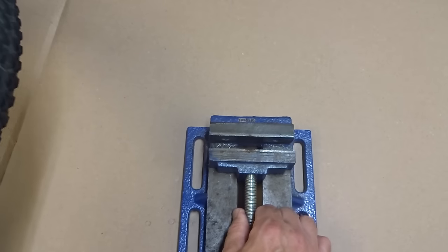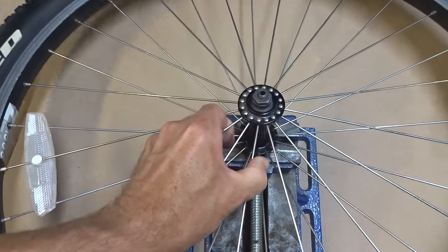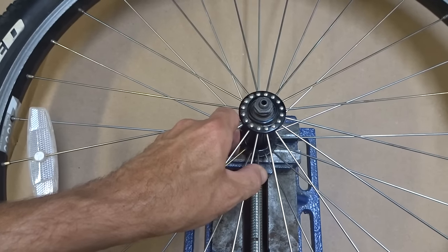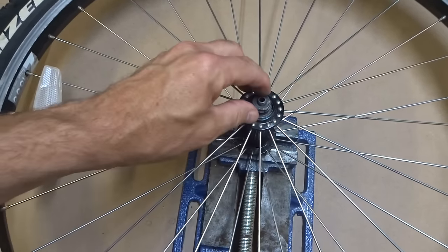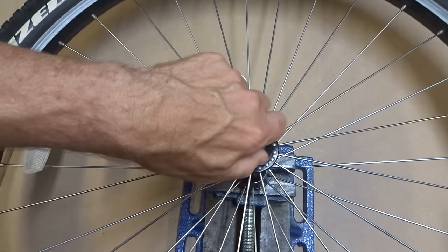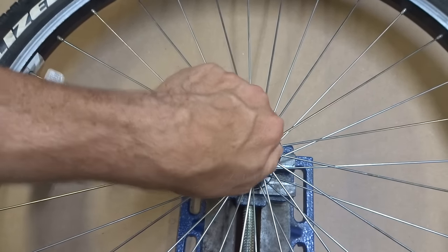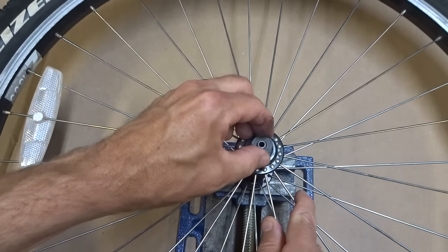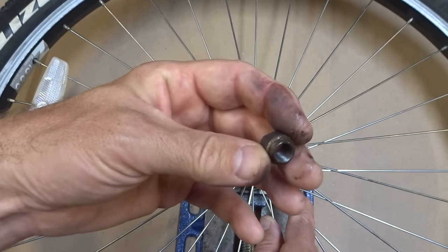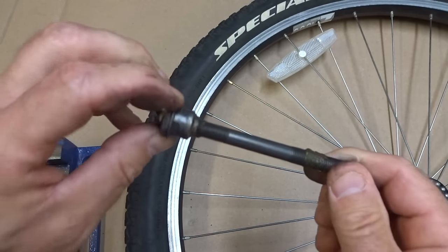To make it easier to work on, I'm gonna use a small vise to hold the nut on the bottom side so that I can unscrew the top side. I'm clamping on to the nut on the bottom side, not clamping on to the axle. People usually ask me about what kind of vise this is — it's called a drill press vise, it's a very shallow vise that makes it easier to work on and shoot videos at the same time. It's so loose that I can turn it by hand without a wrench. So there's the lock nut, there's a washer, and I unscrew the cone. I should be able to just lift the wheel off the axle like that — and there's the axle, obviously not broken.